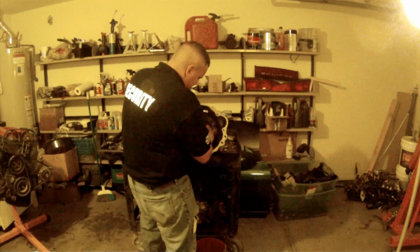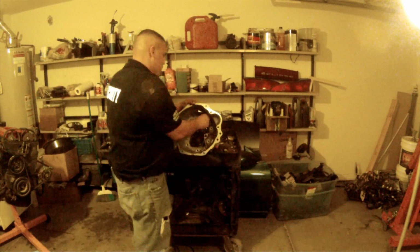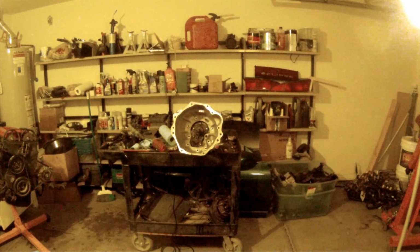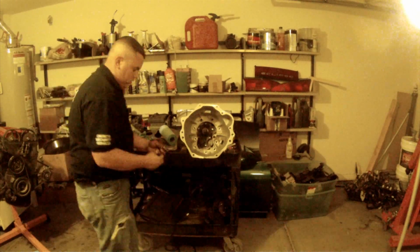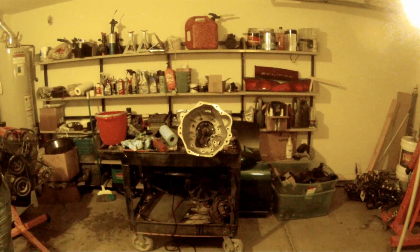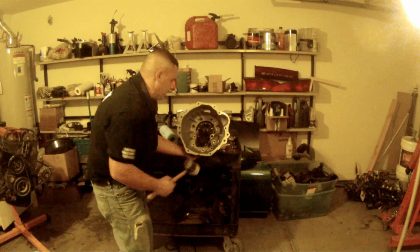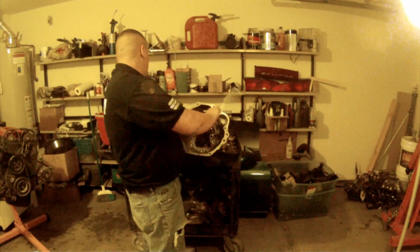At this point, though, I had the Mitsubishi throwout bearing on it, and I'm wondering why it didn't want to go on. So, if any of you want to laugh, go ahead. I just had to return that, and I picked up the Supra throwout bearing to fit in, and now it's fine. The Supra has a wider input shaft, so the Mitsubishi one was just too small.